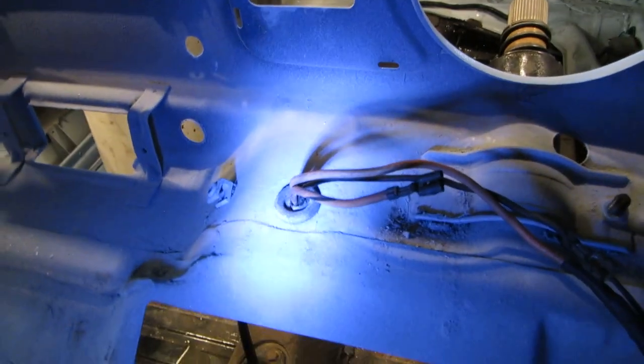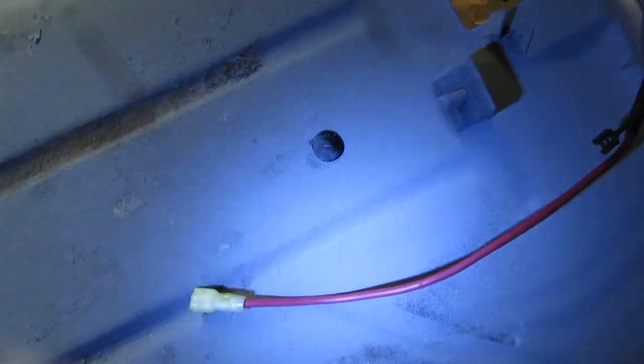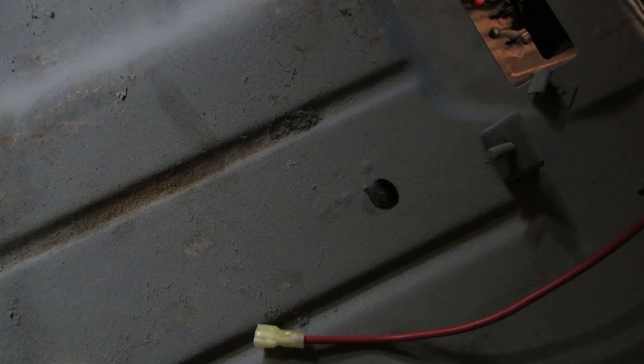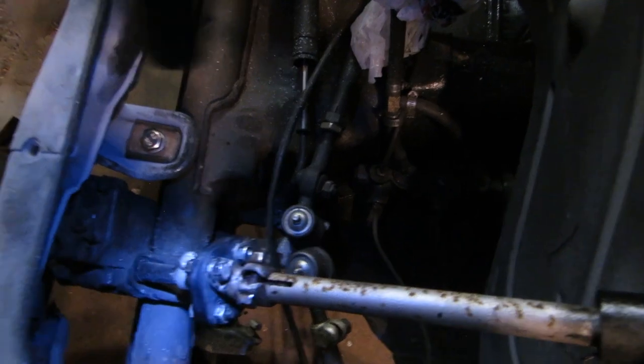A couple of things. I want to make sure you hit all your holes with grommets, or you're going to end up with air leaks. I drilled a hole through that grommet, the little rubber bumper for the steering column, and I put some urethane in it and dotted both sides, and then we put a new flex coupling on there.